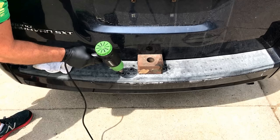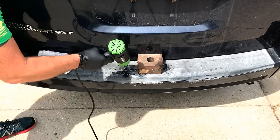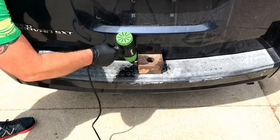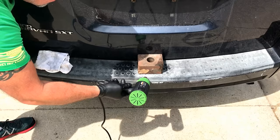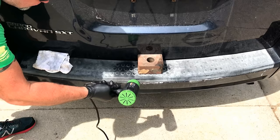Watch the little tread bumps there. This is time-consuming but it works. I have the heat gun on low — you're not melting it, you're just bringing the oils back up that have left the plastic. Once you get it to a certain temperature it goes quick. I know this is amazing to some of you — it's not a trick, you're seeing it with your own two eyes.